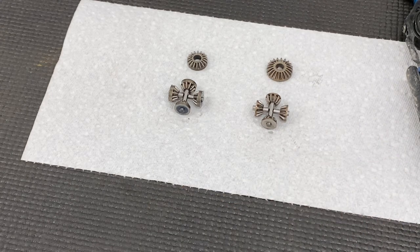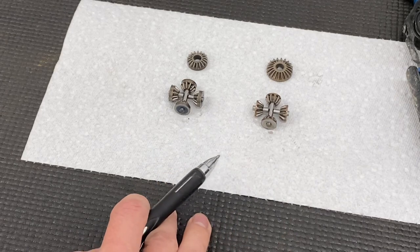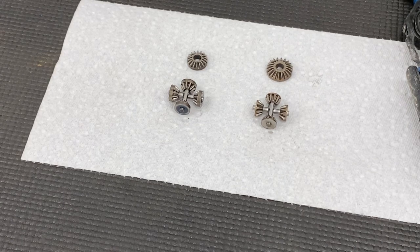Another thing to touch on with LTC gear diffs: you're going to want to use different weight fluid than with HTC. For LTC, it's been recommended not to use anything lower than 10,000wt (10K) in the rear or front. In the front I'd run about 12K, the center is HTC so I run 10 or 7 to 8.5, kind of a mix, and in the rear I'd run 10K. So 12K front, 8.5K center, and 10K rear for an LTC setup.